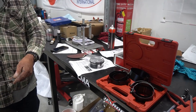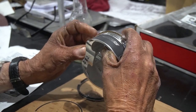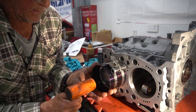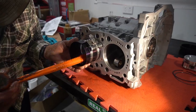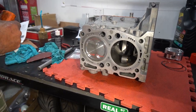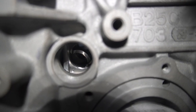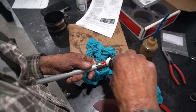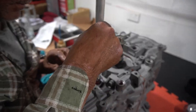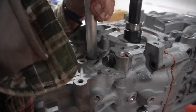Now we are ready for the final piece of the puzzle: assembling and inserting the pistons. The rings are set onto each piston in their correct order and then compressed with an adjustable ring compressor tool. Having our time again, I'd recommend buying the ARP equivalent of this tool as it works flawlessly — this adjustable one wasn't very user-friendly, but it did get the job done. Pistons are then tapped down into the cylinder and lined up with their associated rod. This is another slow and steady process. After they come into alignment, the gudgeon pin is lubed up and slid in — made easy by a tool Dean's old man machined up for it. This process is then repeated for the remaining pistons.